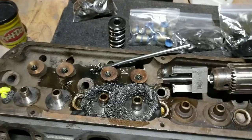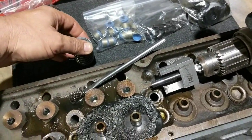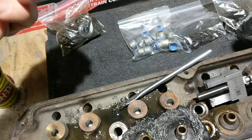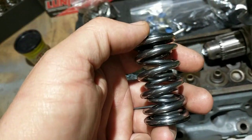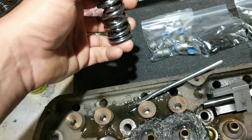The reason I went to dual springs is I had conical springs before and I was always kind of squeamish about running them. With a dual spring setup, if the outer breaks, the inner will hold the valve up — and I have actually broken that outer spring before.